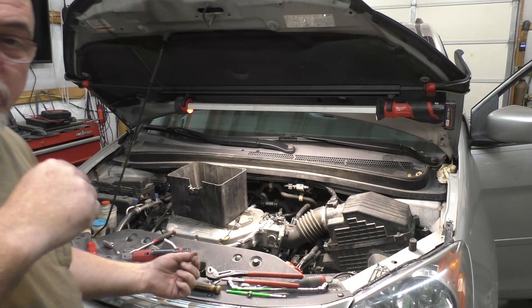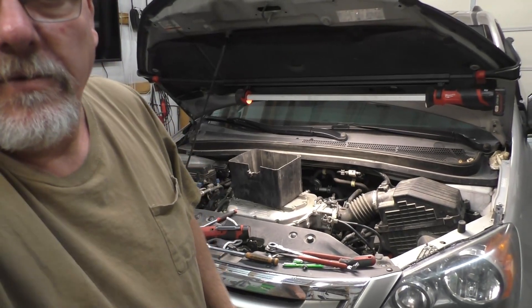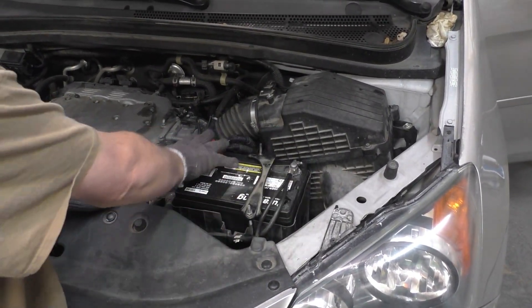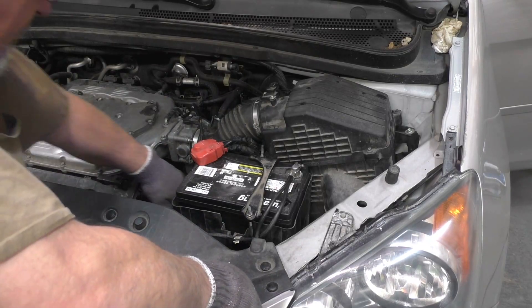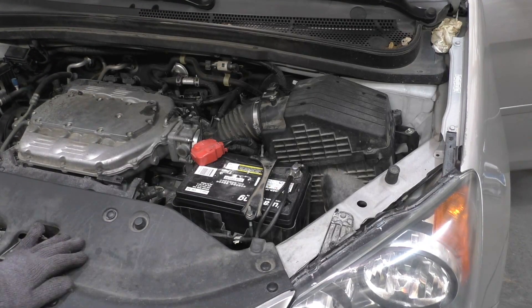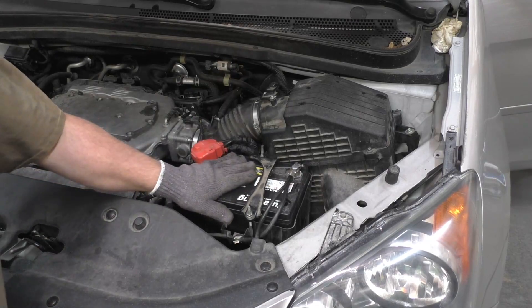While you're down there and everything is nicely exposed, throw a little bit of lubricant on your shift fork — certainly ain't gonna hurt it. Tidy up: get your battery wire clipped in, get your post back on, put your tray in, put the bracket that holds the wire on the side back in. Be sure to place the cover over your starter bolt. Everything is secured the way it was. Thank you for watching — like, subscribe, questions and comments, you know where to leave them. We'll see you on the next one.